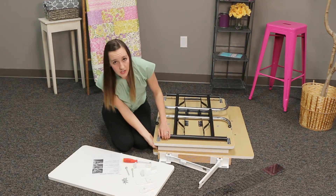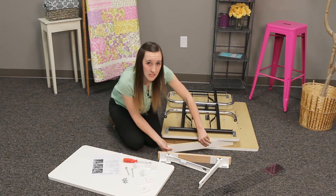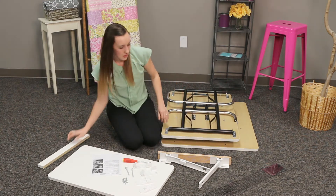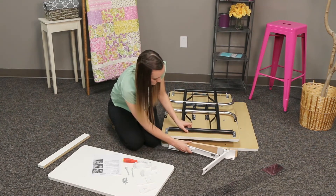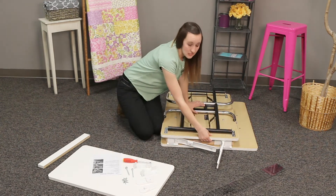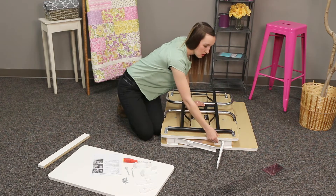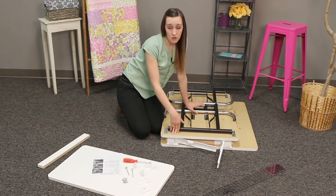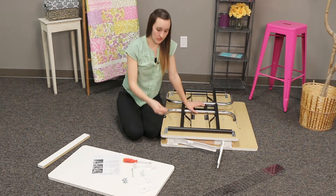Next, let's go ahead and remove this piece under here — it should slide out pretty easily. We're going to replace that with our hinge assembly. When you're sliding the hinge piece in, it helps if you pull upwards on this piece so that it slides in easily. You'll notice that it's snug, which is good. Then, once our holes are lined up, we can replace our screws.